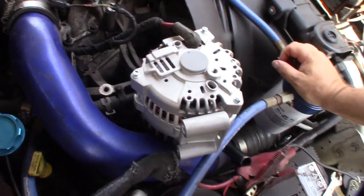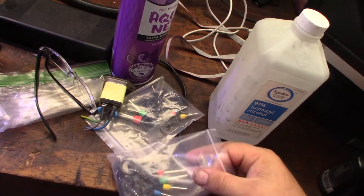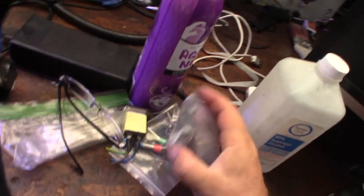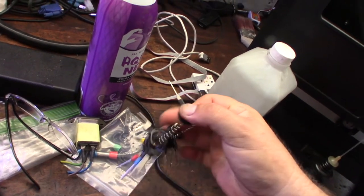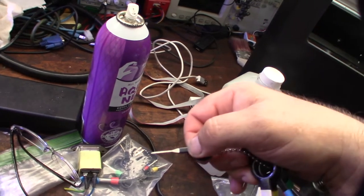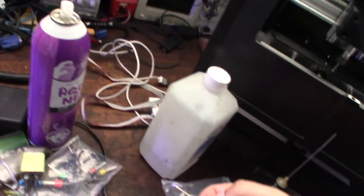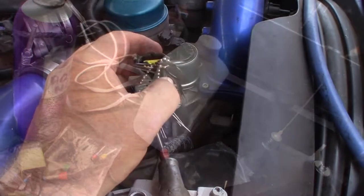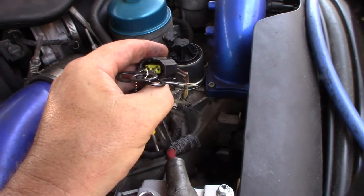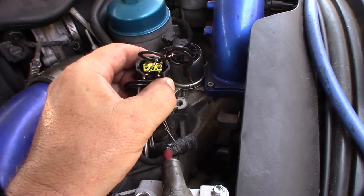I'm never thinking to look at these if you're having alternator charging problems. What I have here are these universal keys that remove basically every single connector. I want to remove the connector so I can actually put some shrink wrap over that wire, because I don't want to cut and splice and have to solder. If I can get them out and pull them out and get some shrink wrap on them, that's ideal. I've got to take out that little plastic retainer, and having those two things in there kind of lifts up the back where it locks in. Hopefully I can get that pulled out.